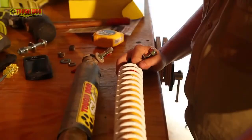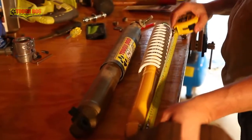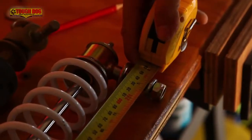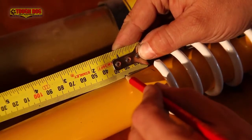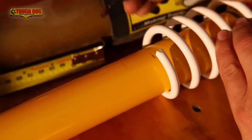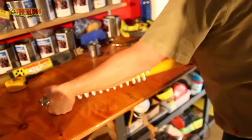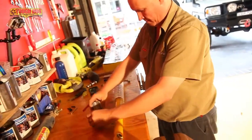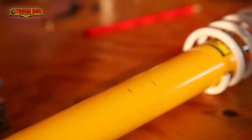Once you have unpacked your return to centre damper, extend it to match the measurements you took earlier, taking care to measure from centre of mounting point to centre of mounting point. Now it's time to fit the retaining collar for the coil. Grab your texter and mark where the tail of the coil spring meets the damper body. Then grab your measuring tape and carefully mark another line 27mm further along the damper body. Fully extend your damper to make room to fit the collar, then grab the bottom half of the collar and carefully line up its base with that second texter mark.